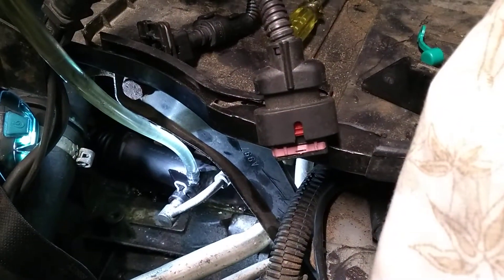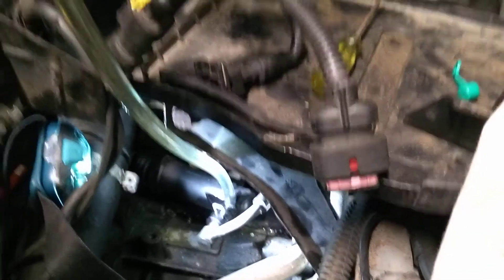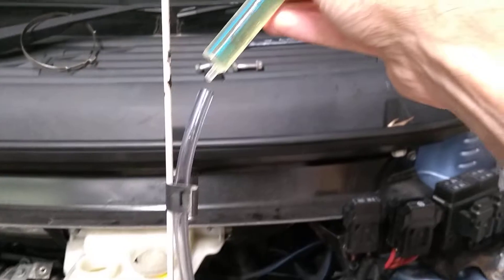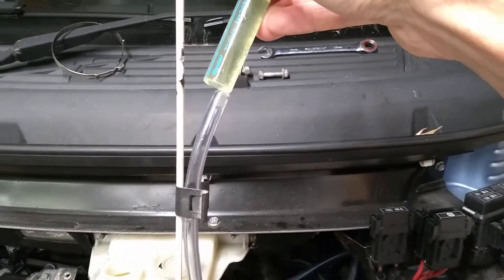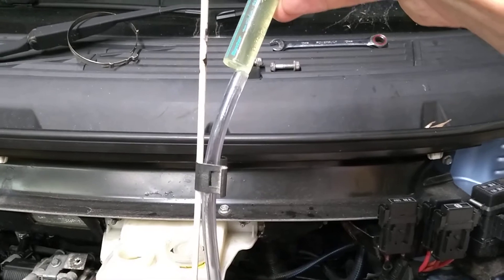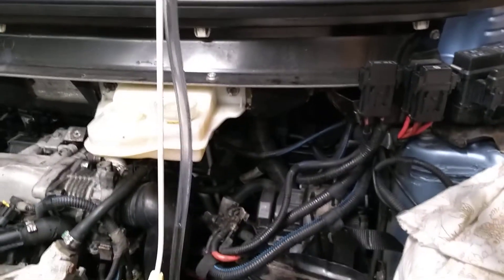And in the end tonight is a much simpler system, which is just putting a plastic pipe on top of the bleed nipple, opening it up and putting fluid in the top of the tube. This is reverse bleeding — it just allows the fluid to go back through the system in reverse, taking any air with it along the way.